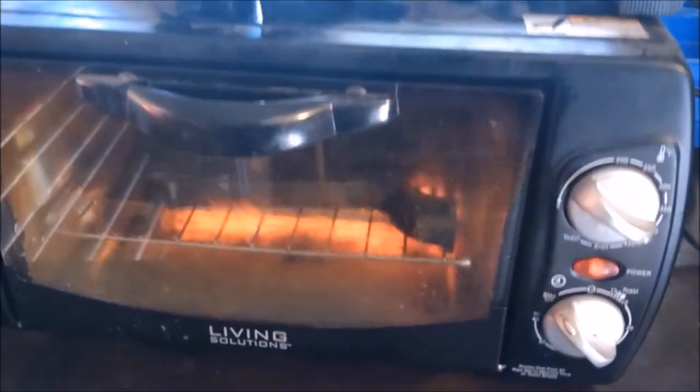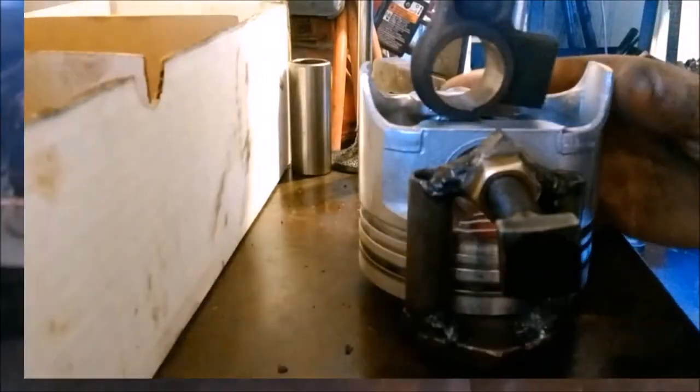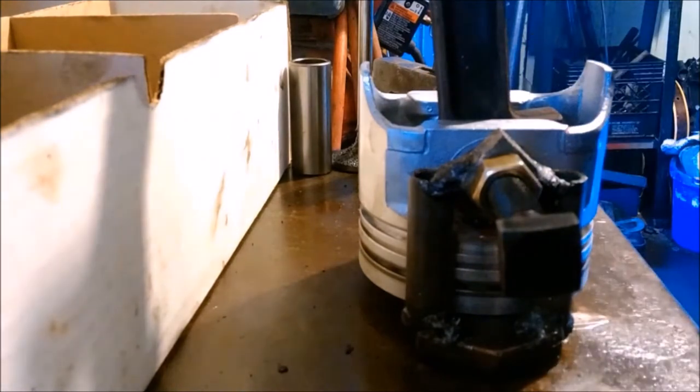Our rods are in the toaster oven getting up to 375°F; the pins are in the freezer. We're getting close — about 350°F. We've lubed up the surfaces, wiped everything clean, lubed the cylinders, and installed our rings. Everything's lubed up. We're going to drop these in. The chamfered side goes towards the front. We'll install our bearing and torque it down, evenly torquing about halfway, then the rest of the way.